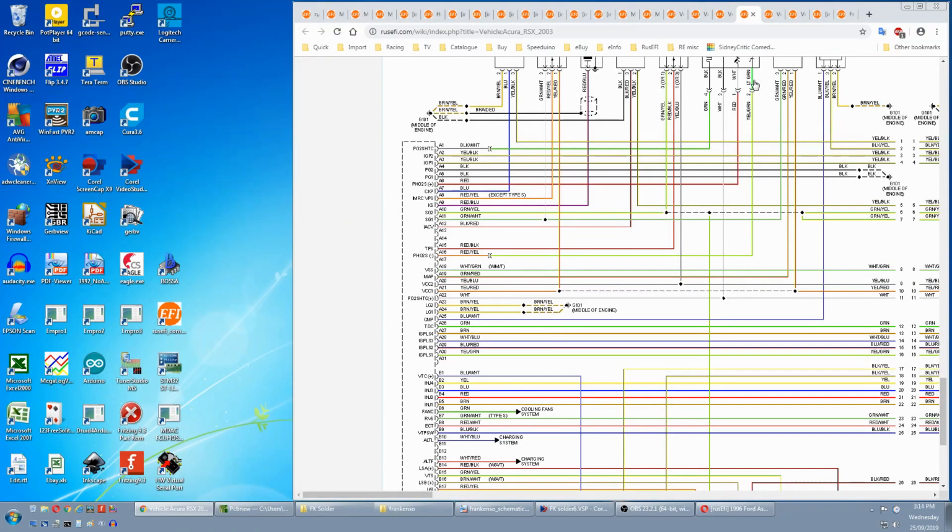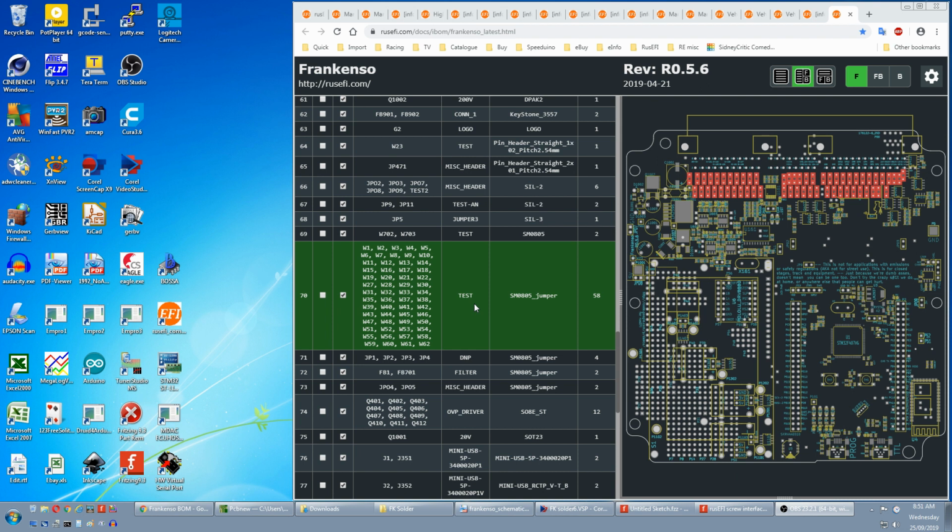The kit comes with 30 0-ohm resistors, which should be enough for old cars if you selectively fit them. I think my 91 Mazda uses about 20. But if you want to fit all 58, which is easy enough to do before it goes in the soldering oven, you'll have to supply another 28.